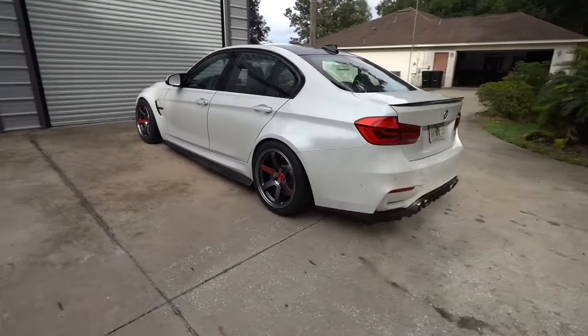The car feels great, though, on the NT01s. Dry, man, it's wild, the difference. Ben's always had, since maybe the first or second trip I came, upgraded tires on the stock wheels. Like, he's had 200 treadwear tires. I always had the stock Michelin Super Sports or whatever they were. So for me, it's a dramatic difference. I can actually get on throttle coming out of a turn early and not just dance around. I even turned the manual drive mode off, or full traction control off. I used to leave it on just because the tires wouldn't hook.